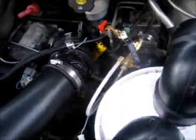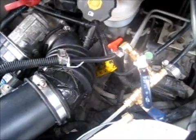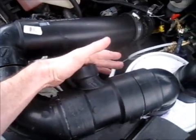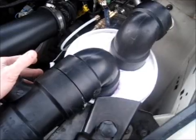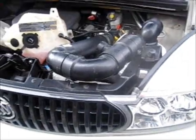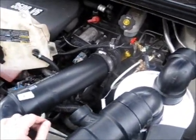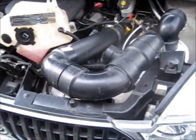This is my air intake manifold — this is the actual original hose that went to it. Once I get my car going I'm gonna shut this off and have my hand over this air inlet right here. This air inlet dilutes the mixture so there's not as much vapor being pulled through. This right here proves that you don't even need an ultrasonic transducer to run your car. I have driven down the road with it — my wife was driving and I was managing it — and it does work. It will run under load just fine. I want to install my check valve setup first before I do that; I don't want to fall off and get run over.